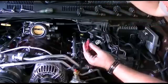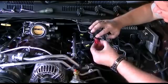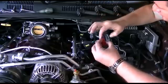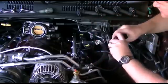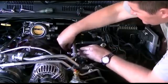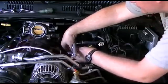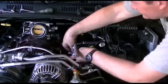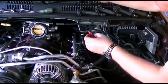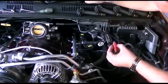I've put most of the injectors back in apart from two. I've got a little bit of thin synthetic oil left over from when I did the oil change, and I just rub that on the O-rings — just makes it a bit easier for them to go in. Put that back where it came from and click on the plug. Make sure it clicks. Not too much oil — just get dust on it and get dirty, you don't want a dirty engine.